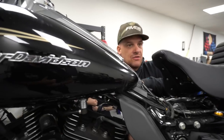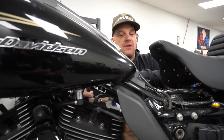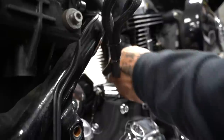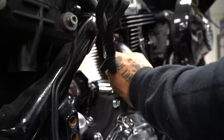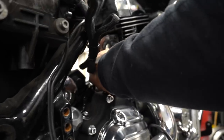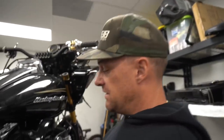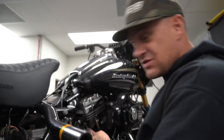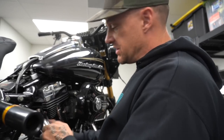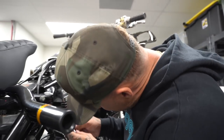I'm going to open it up between the motor here, get a little more airflow and a little less in my way when I work on this bike down the road. This is pointing straight down into the top of the tranny — you put a big wideband O2 sensor in here and there's not going to be room. It needs to come out differently, otherwise it's in the way. O2 sensors close to the heads is where they should be — O2 sensors way down here are way away from them, not really doing much, especially if it's a wideband. You need that up close and personal.